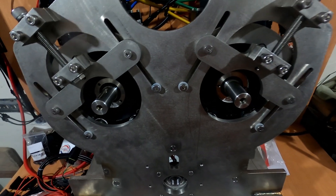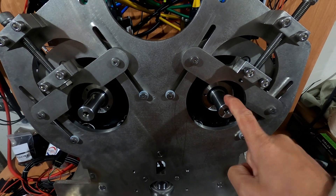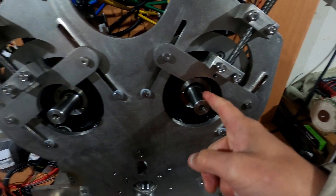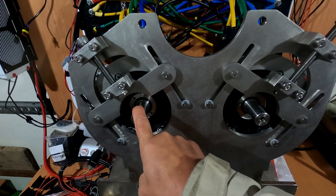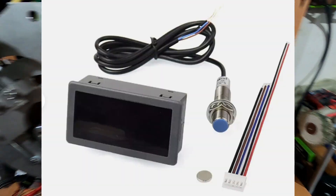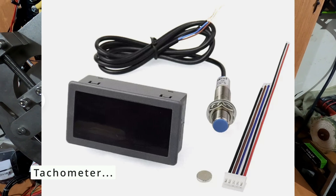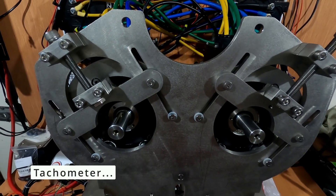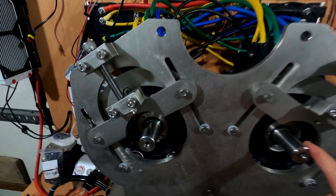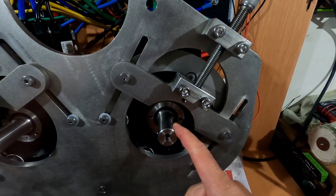The interesting part when I connect this to a battery is to see if, controlled by one throttle, the RPM on both of these motors are identical. If not, then I obviously have to set that in the configuration somehow to make sure they run at the exact same RPM. To be absolutely sure that this is measured correctly, I have some external magnet sensors which I'm going to fit onto here and here for testing. Just to make sure that the reading I get with the Golden Motor app corresponds with the analog sensors that I am mounting straight onto these shafts.